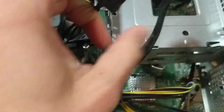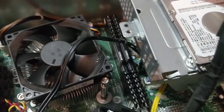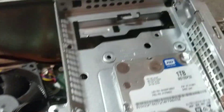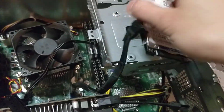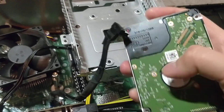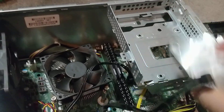Here's the power splice. Here is an SSD — you put it right here. That screw right there and that screw right there. Also touch your power supply first before you actually work on this because you want to discharge all the static electricity from your body. There are four screws to attach it.